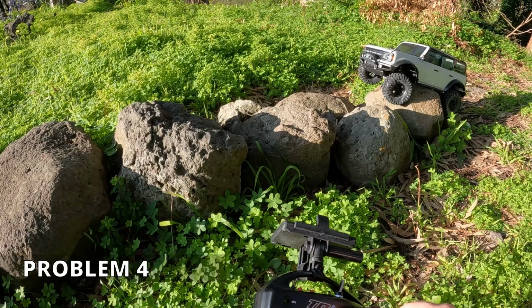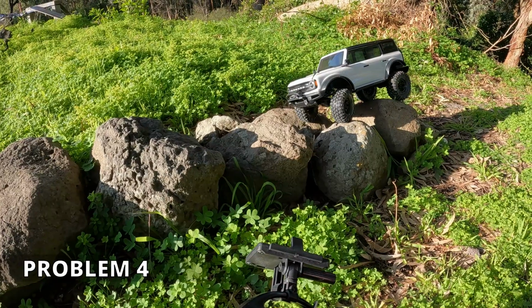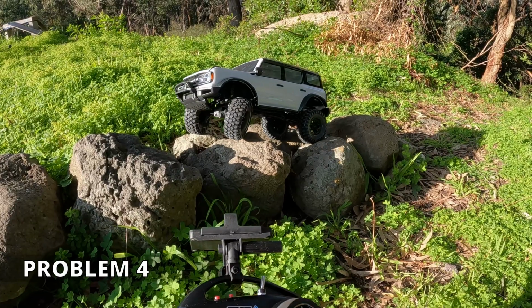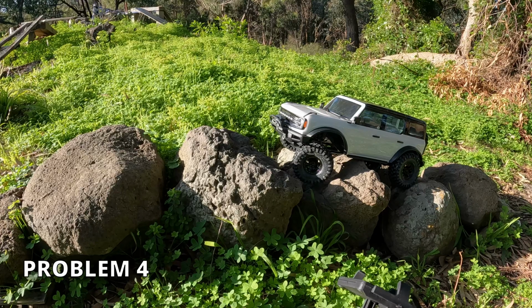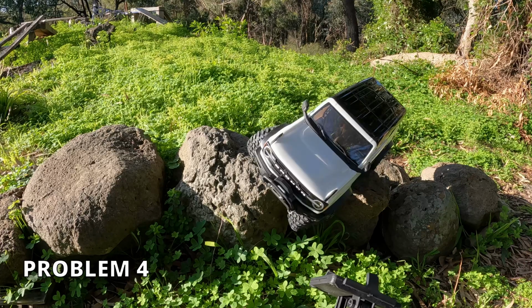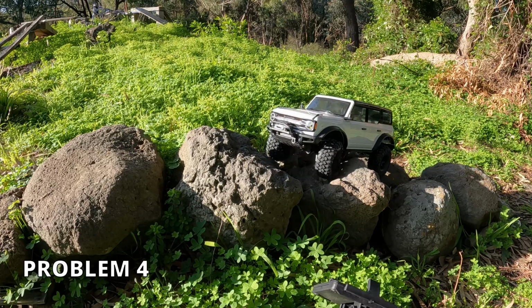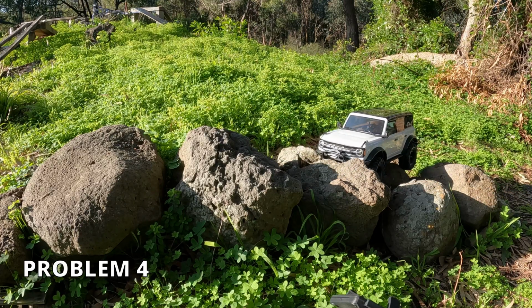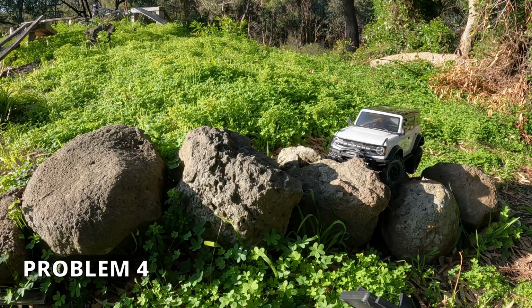This one tests breakover, and it's also really hard on the servo. I don't have high hopes that the Traxxas servo will survive too many attempts. We also don't have a very strong drag brake out of the box. I haven't adjusted anything yet. I will. It can't even overcome that. Ooh. Nice thing about the, as bad as the servo is, the stock tyres are very good. But we are going to kill this servo. I don't want to. I can't even steer. I'd say the servo's fading now.